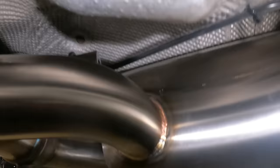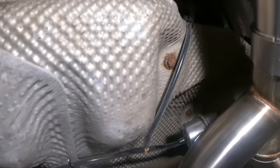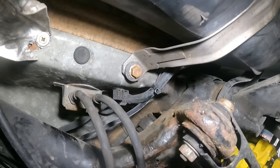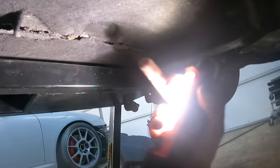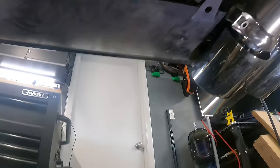Let me show you everything underneath because it's done. Coming off each actuator I have two little zip ties and the heat shield to keep it nice and tight, and then it runs up and over the subframe and ties in with the other brake lines and associated things there, runs back along there following right under here. Overall very happy with everything under here. This is finished - now I get to work on everything up top. I also need to put some screws in here that weren't there even by the previous owner.